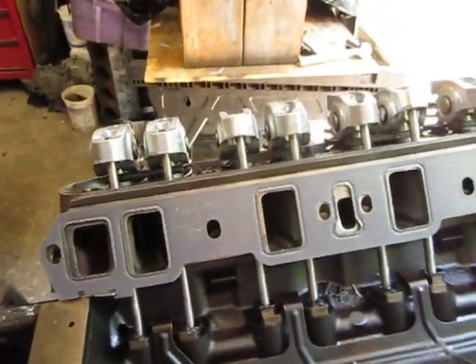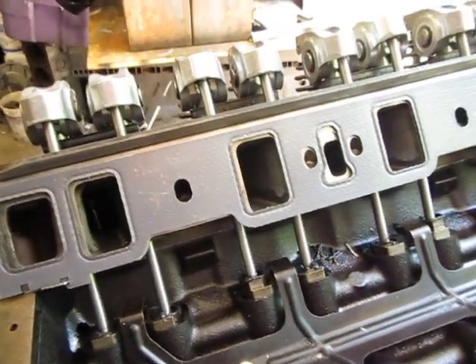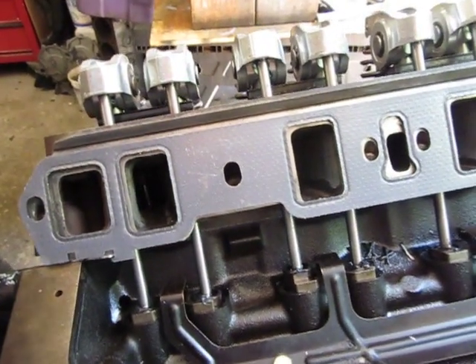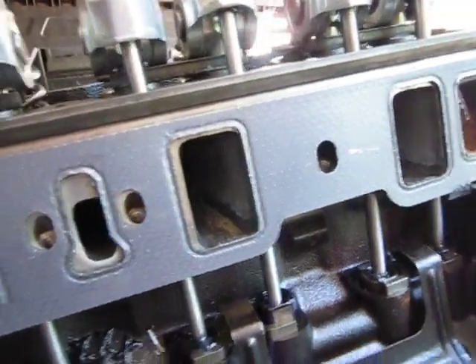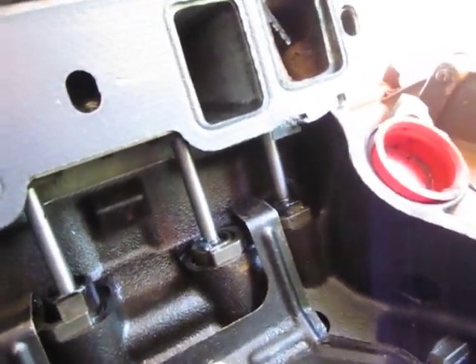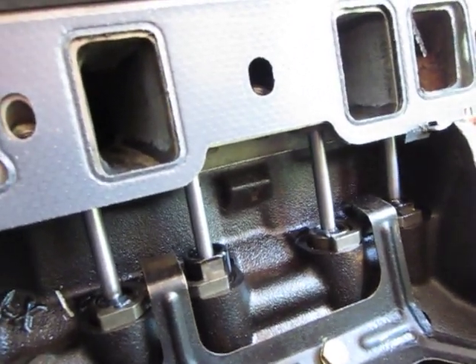I was just going to point something out that I found on this intake manifold. This is for an engine that's going into McNugget. I did a little work on the heads — they're a set of GT40Ps. I went to put the intake manifold gasket on and noticed how far off it was. What I had to do was notch the intake manifold gasket right there where it meets that tab for the head, and now I'm able to push it over a little bit.